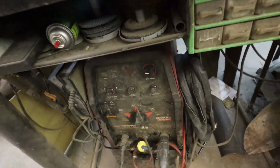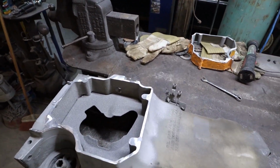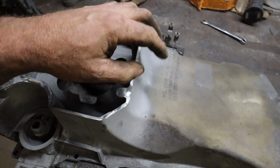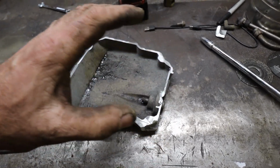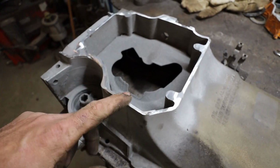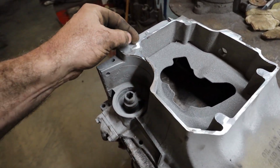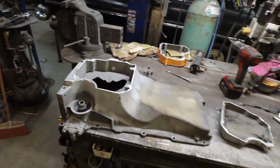We're going to fire this sucker up and, like I say, some folks were suggesting, because this is super clean here, I don't know if this is going to be porous, but I'm going to try to dab around the whole edge, build myself a little bead. Same thing on here. So then I'm going to be welding good metal to good metal and bypassing the garbage that's on there. Hopefully if I succeed, I'm going to have no leaks, so we'll see. Either this works or I'm going to do my JB weld thing that I always do, so no fret either way.